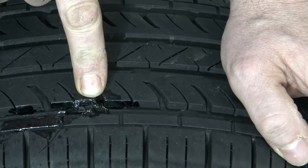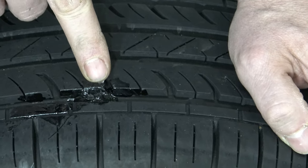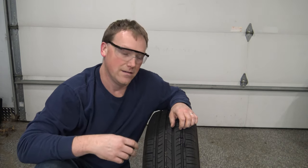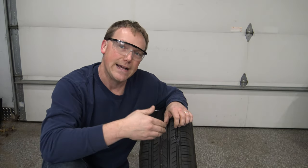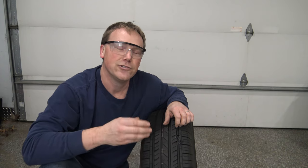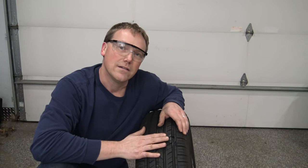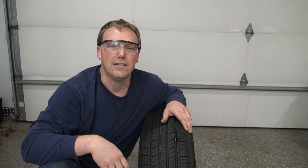You should see glue oozed up around the edge. One key step: wait 20 minutes before you add air to this tire. If it's your first time you're going to struggle a little bit — it takes more pressure than you think to get the rasp inside the hole and clean it out. Make sure you use a lot of rubber cement; don't go easy on it. Keep the plug in there after it's glued for a good 20 minutes before adding air, and it should be fine.